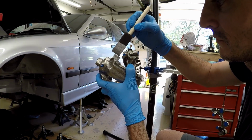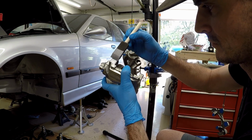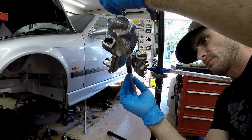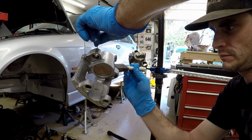I decided to use G2 caliper paint due to its supposed durability. G2 is a brush-on paint, so I used a dabbing technique with foam brushes to ensure light, even coats without brush marks. Each part received 2 coats, 15 minutes apart.